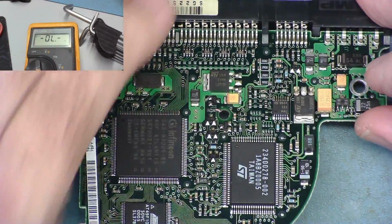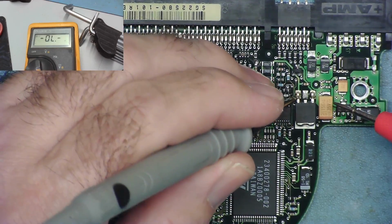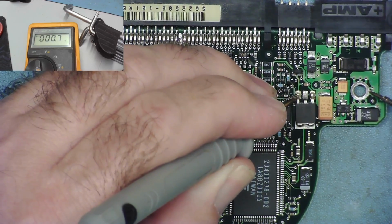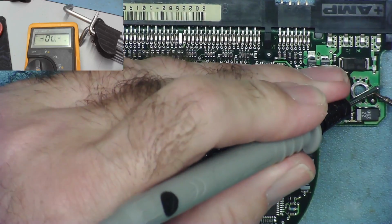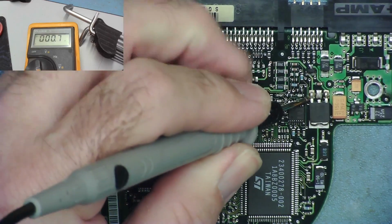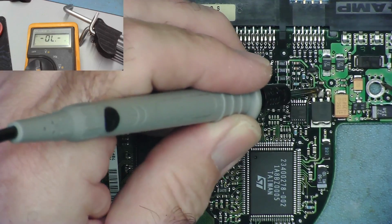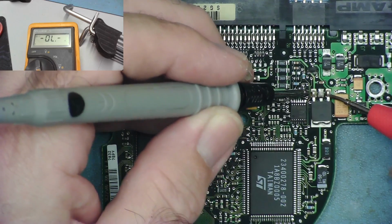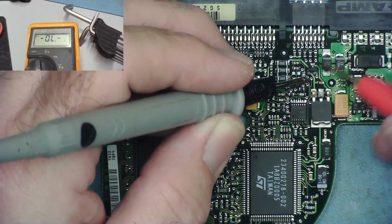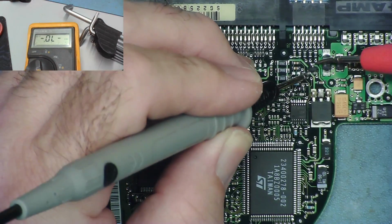I've just had a little bit of a poke around this, and it doesn't make a lot of sense exactly to me. So we know this pin is connecting to ground. What you're reading as well, it's almost ground, it's very close, low resistance to ground. But it's not quite. Okay? This pin doesn't go to ground, this pin doesn't go to ground. Now this one goes to the output of, I'm guessing, collector or drain or source of this little thing, which could be a transistor, bipolar, could be a MOSFET. Yeah. So let's have a quick look.